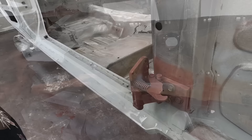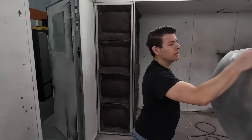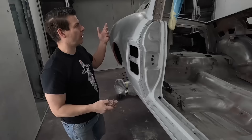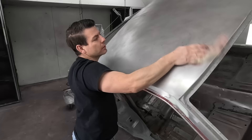Originally they just stuck these on and it was bare metal between the two hinges, so they've got some protection between them now. All this area has been acid washed - it's a metal cleaner but it's an acid that etches the metal and cleanses it. I'm tacking off the steel so I wiped it all down and cleaned it. All this will be re-sanded and primed, but just tacking off to avoid having a bunch of lint in it.